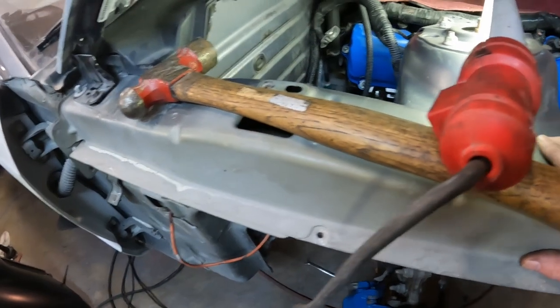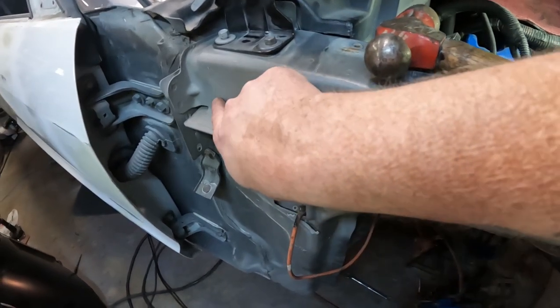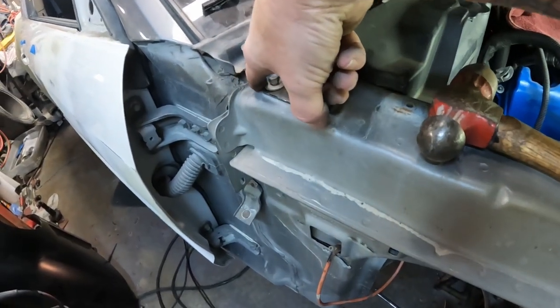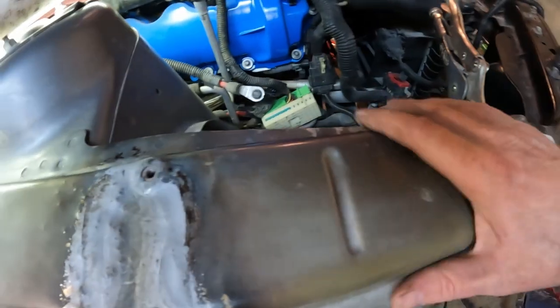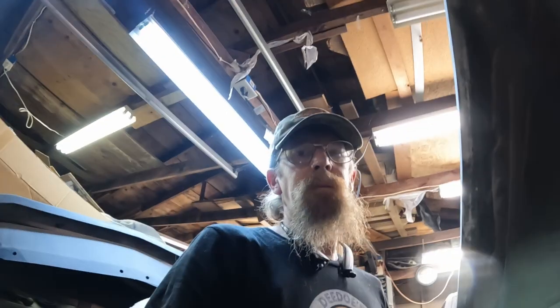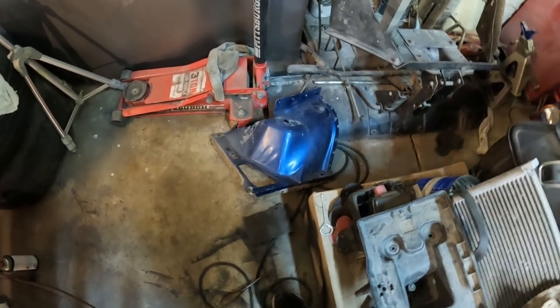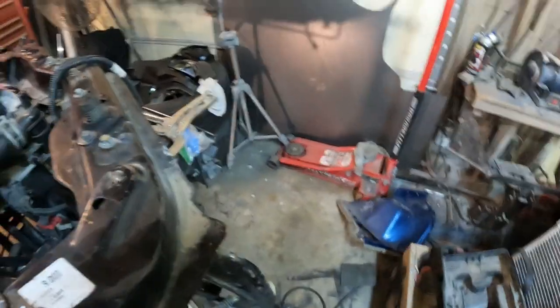So the only way to have a good quality repair on a unibody car is to replace the entire section. If I was going to replace this upper rail cover, I would have to replace this entire upper rail cover all the way back, and it comes all the way back underneath the hood hinge and comes all the way down. I would have to replace this entire piece. Same thing with your front apron, which I got from the junkyard. If you check my channel, you'll see I have a junkyard trip video where I cut that piece off. You want to replace the whole thing. You don't want to just add and have some welds holding different pieces together. That's never going to be a great repair. You're already going through doing it, so do it right, and you'll have a much better outcome. It'll look a lot better.